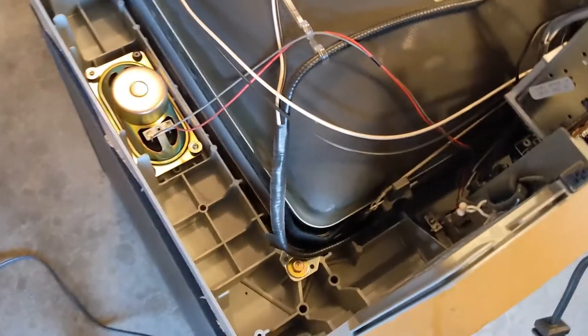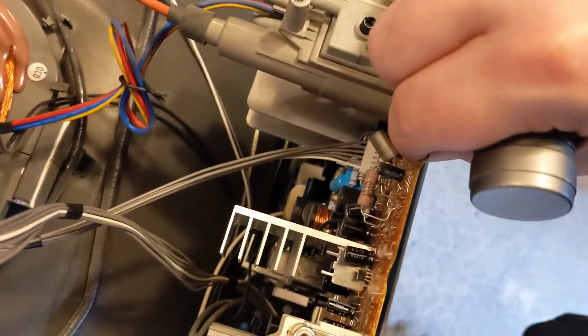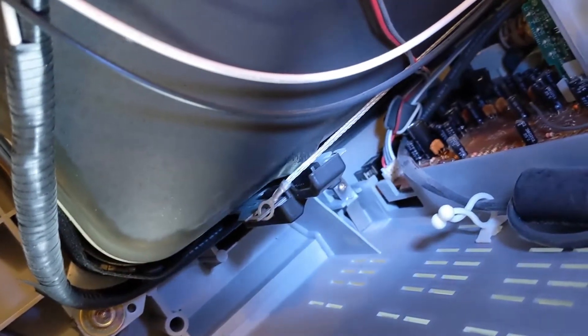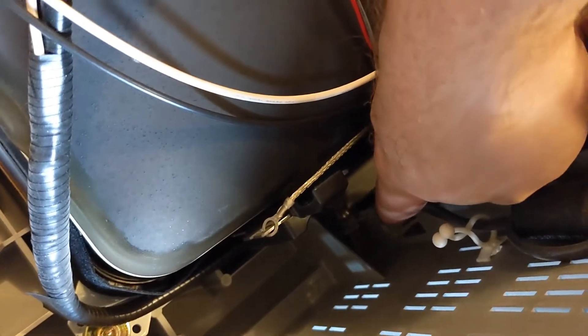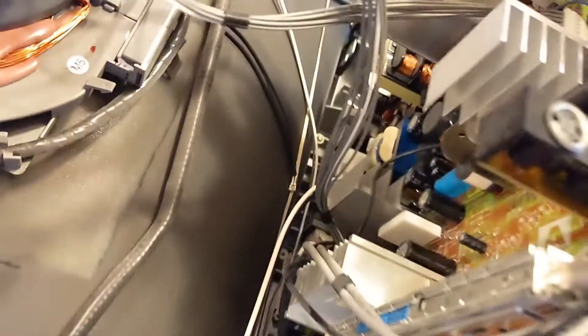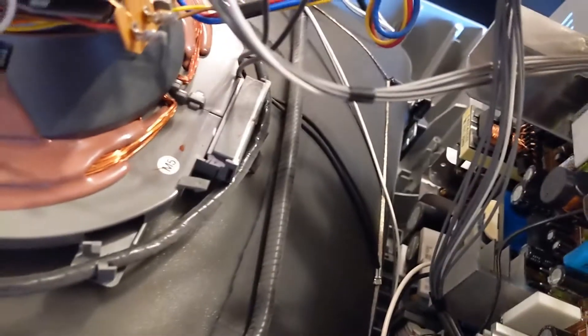After blowing out some of the dust and reading the service manual and having a good look at things — if you simply try and pull up on the board, it's locked into place. But I figured that if you release that little tab there, press it downward towards the bottom of the TV, it kind of releases it. So if you press down, it allows the board to come out. Now I can actually pull the board further out past that lock. Now I have a lot of wiring to disconnect as I go here, so maybe I'll just try and describe what I'm doing as I'm doing it.